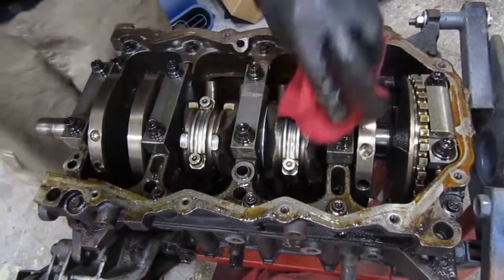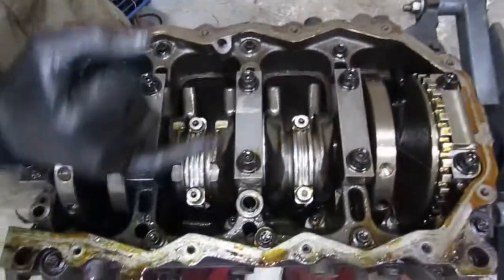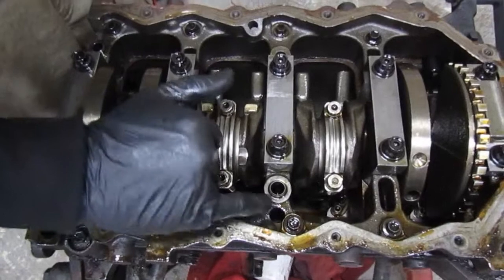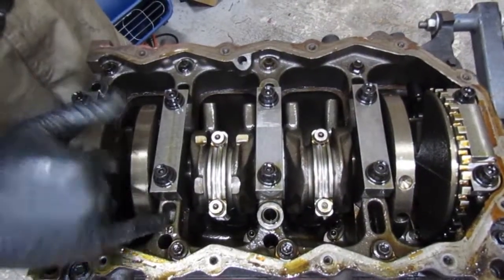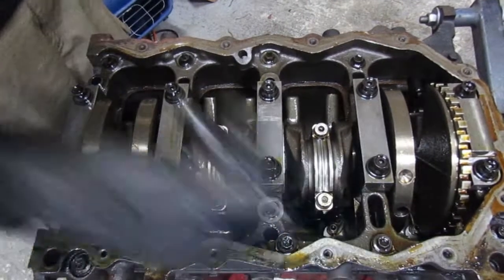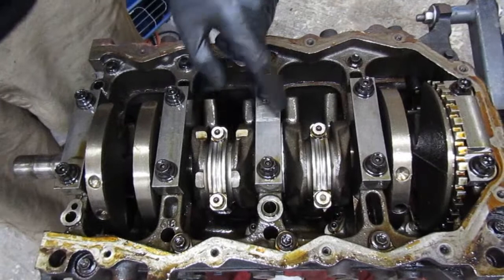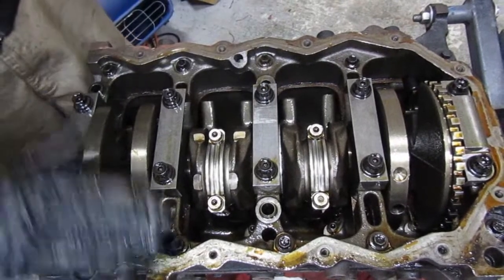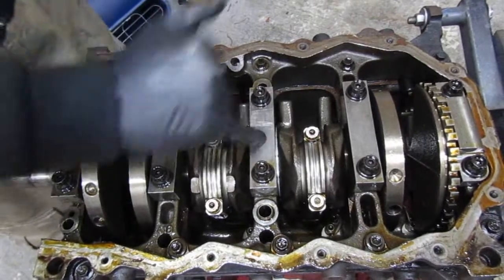This is what I was talking about in the first video. Normally, these right here just have like little tiny waves over them, or they're like kind of that same material. They're just little humps over it. Once you start to build these too, they do crack right here on the crank. And so this is the kit that we got. There is direct fit ones. This one right here you actually gotta bring to the machine shop and they cut the bed plate completely flat, and you just bolt these right on top of it.